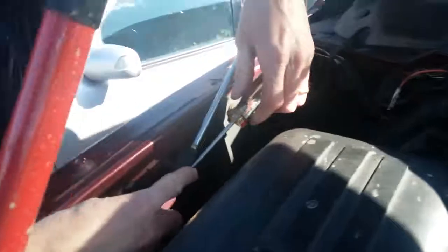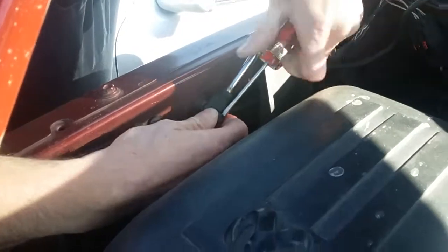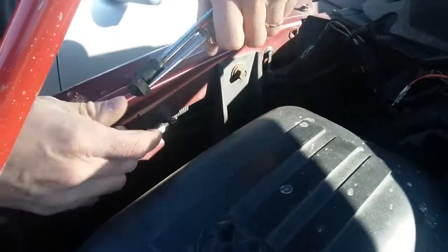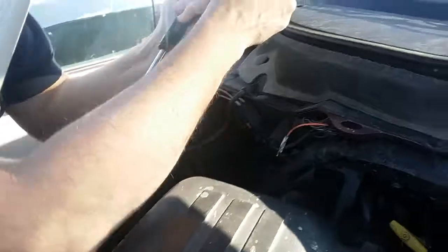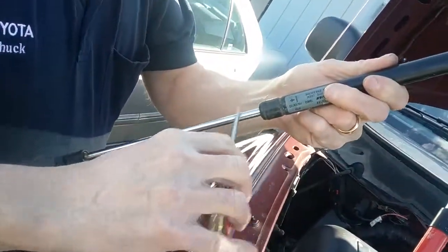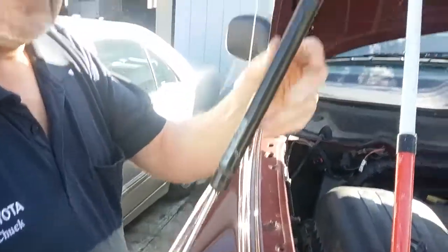So right here is a clip with a groove for your screwdriver, and we just pry that out and it comes right off. We do the same for the top — it comes right off. The slimmer part of the shock goes on the bottom because of the way it dampers on the inside.